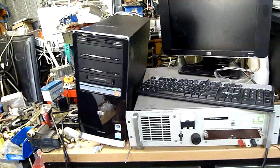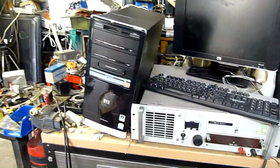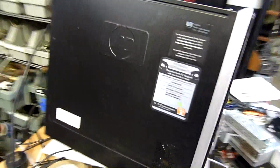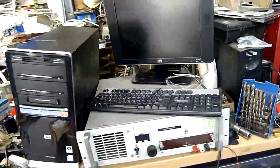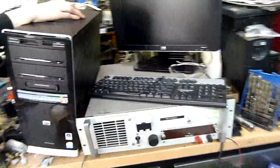I'd certainly fix that. I'd also check the power supply first, just in case you're not getting 3.3 volts or something. I wouldn't turn on without any of the voltage rails. Oh, true, yeah, because you used to have the hard start. Computers aren't hard start anymore, which is probably good. You know, when there's a short circuit, they can shut down instead of sitting there smoking.